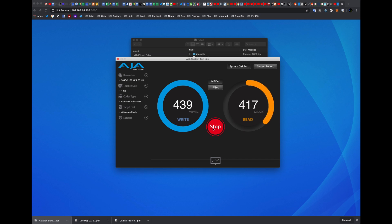The Synology DS1819 Plus is rated to deliver 2045 megabytes per second read and 650 megabytes per second write, so we're quite far from those numbers in that last test. I wanted to see if we could reach higher throughput by switching to a RAID 10 configuration, which theoretically should allow for better read/write performance versus SHR2, which uses a variation of RAID 6. But since RAID 10 requires an even number of drives — half needed for redundancy — I had to wait to order a 6th drive, and that's where we last left off.